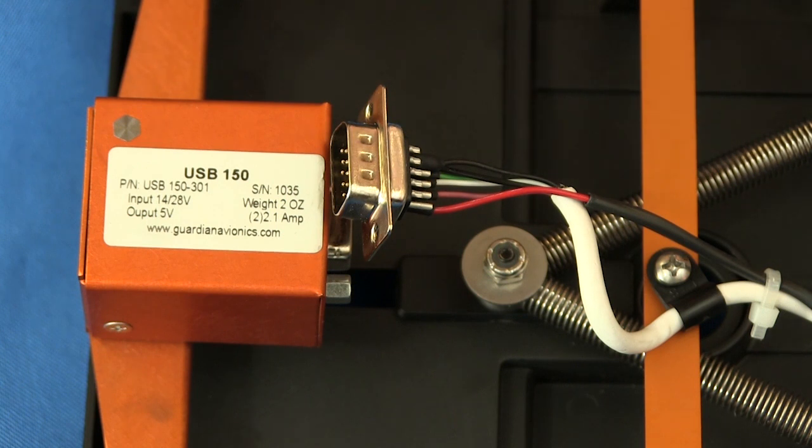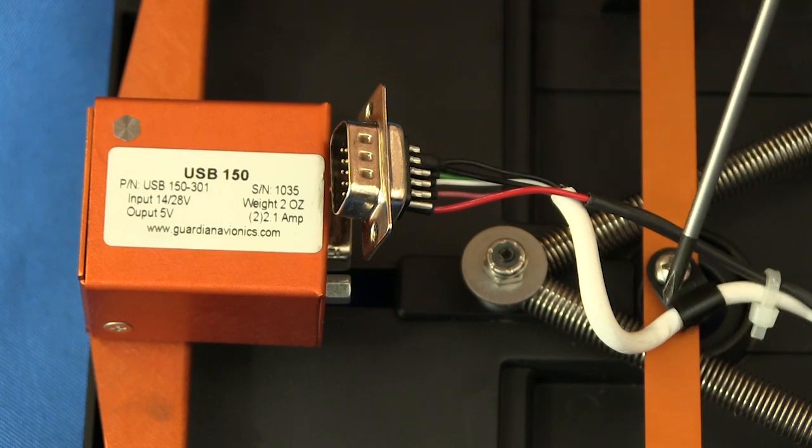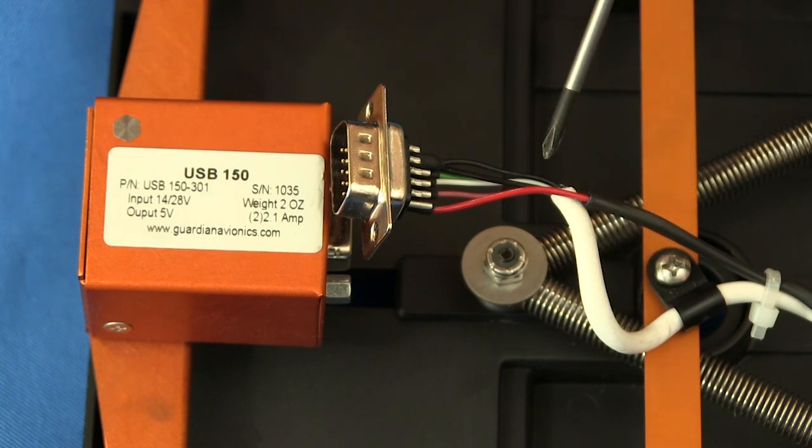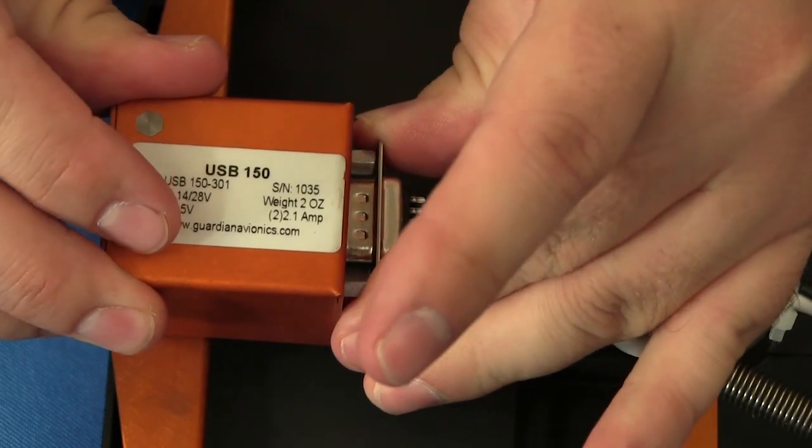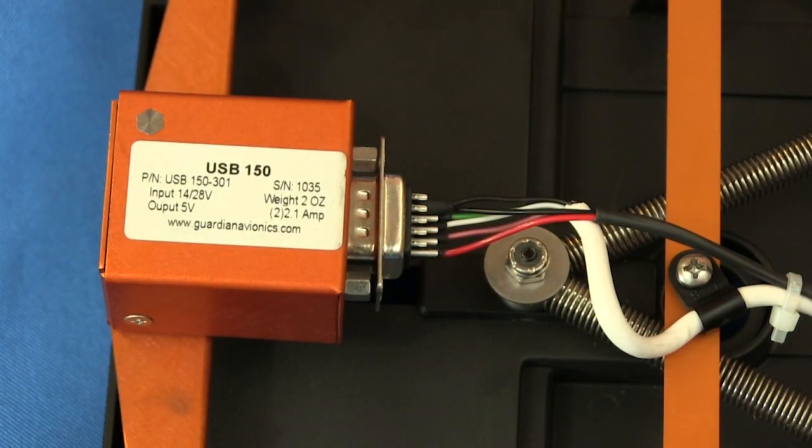Wiring is simple. Just connect your 9 to 48 volt aircraft power from a circuit breaker and connect ground into the power supply. Then connect the lightning cable that will provide power to the iPad or iPhone. The result is a stable 2.1 amp charge at 5 volts to keep your iPad charged and functioning during flight.